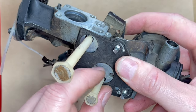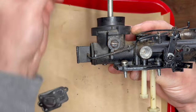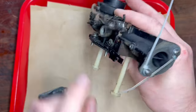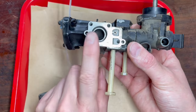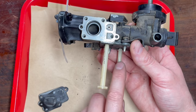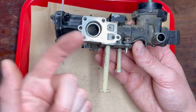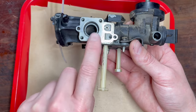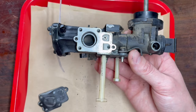It will fall into another little chamber inside your fuel tank. This acts as almost like your float bowl and then that's going to get sucked up and that's going to get metered by your main jet — that little brass one here — where the needle sits in, and then it's going to go back through the intake and then you're going to have that whole cycle completing. This pump is constantly going and it's going to constantly keep sucking up fuel and putting it into this bowl, and there's actually a little notch in the bowl so that fuel can actually flow back down again. So it's this continuing cycle of vacuum pulling on the diaphragm, fuel coming up through down into the bowl out here, venturi effect is pulling it up this tube through the carburetor and into your engine.